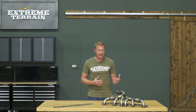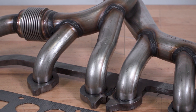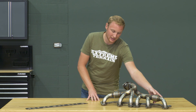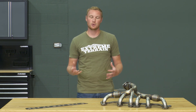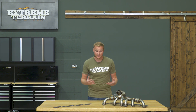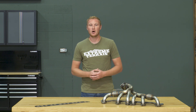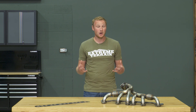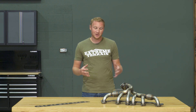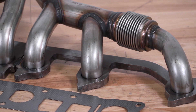The straight six is a great engine, but it does produce a lot of heat and a lot of vibration, both of which can lead to cracking manifolds. So a lot of the aftermarket, this one included, has a piece of flex pipe built here and here, and that's going to help absorb some of that expansion and contraction that happens from the heat as well as absorb some of that vibration to keep this from cracking down the line. If you've installed an exhaust manifold on your straight six, having something like this where it's not going to crack again in the near future is going to be great.